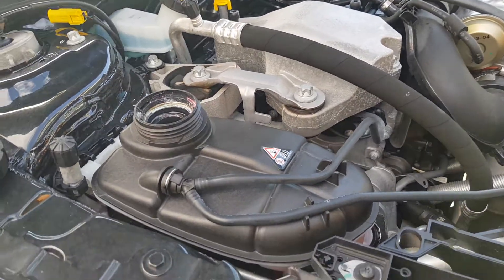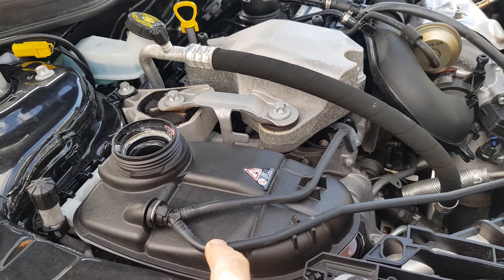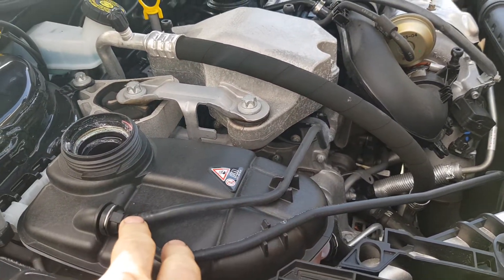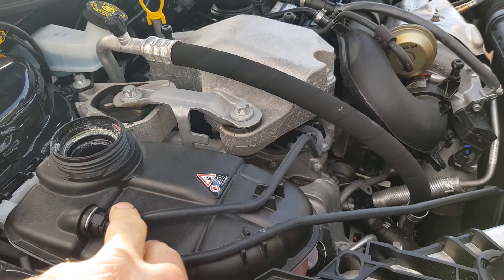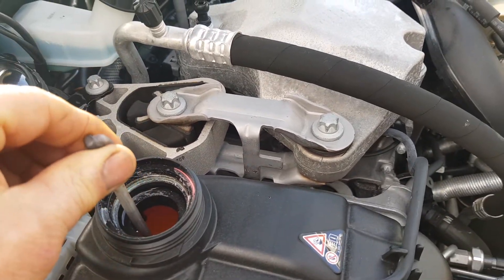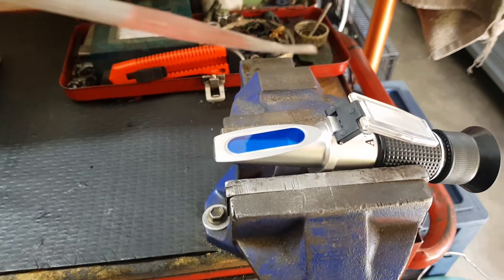On this particular car, all we need to do is take a sample out of the reservoir. This is a pressurized reservoir — if it's not pressurized and is just an overflow reservoir, you need to take the sample from the radiator via the radiator cap. But this is the radiator cap; it's pressurized, and these lines circulate coolant from the engine and radiator into this bottle and back out. So what you get out of here is exactly what you'd get out of the engine and radiator.